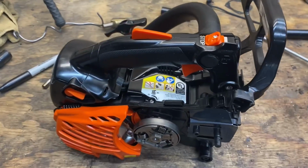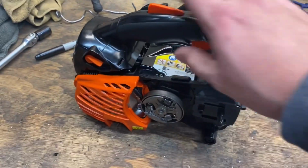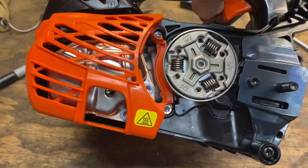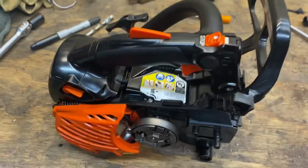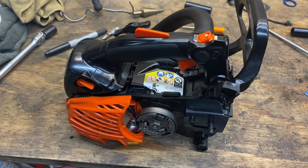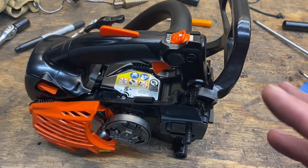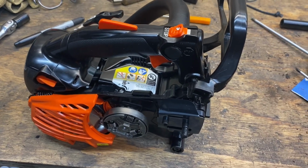I also took 25 thousandths off the key to do a timing advance, and then I also did a really basic muffler mod, drilled a hole all the way through. And so basically you would be getting a brand new cylinder, which you would do a base gasket delete, which puts the squish right around 20-22 thousandths, which is why I didn't do any machine work.